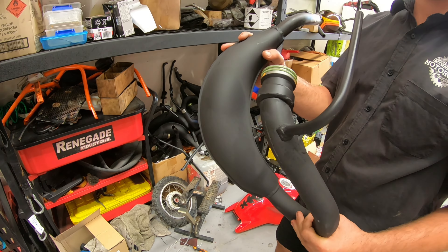One thing that I didn't know is they pull apart the carby — I think there's restrictors in there — and they change the jetting. They said that on a four-stroke it can take almost a day, like five or six hours worth of work, because they change gearing and all sorts of things. It comes in the crate as a registerable road-going dirt bike for Australia with every bit of ADR gear on it, which is just not needed when we're riding in the bush. As they're pulling stuff off I get very excited about the charcoal canister — I'm thinking that's going to be perfect for my scrambler build, probably as the radiator overflow or something.